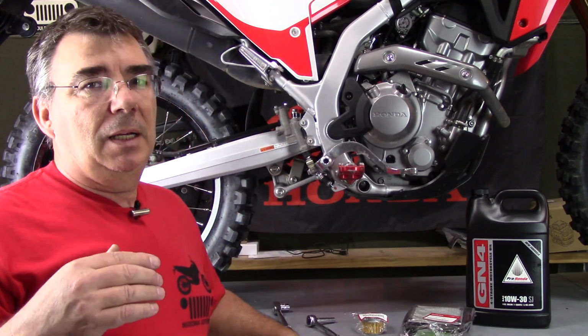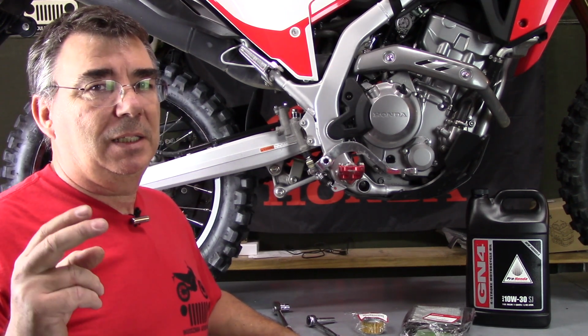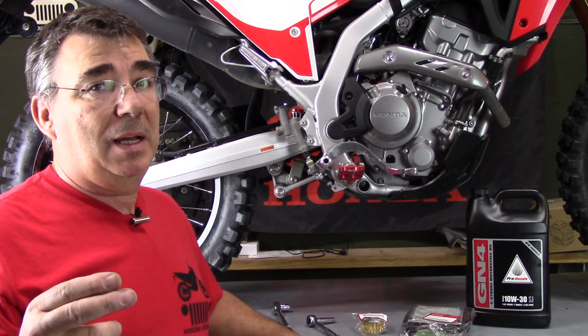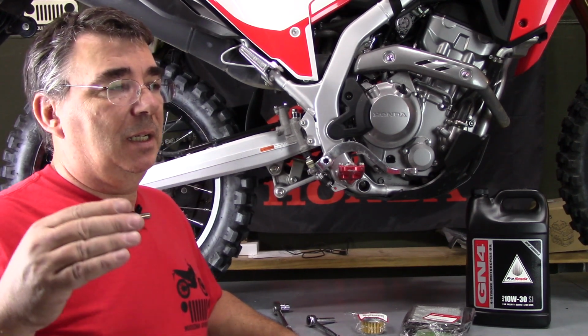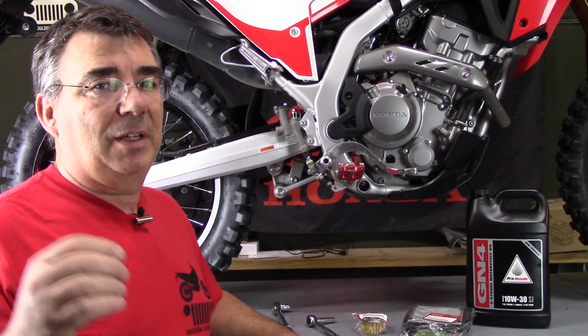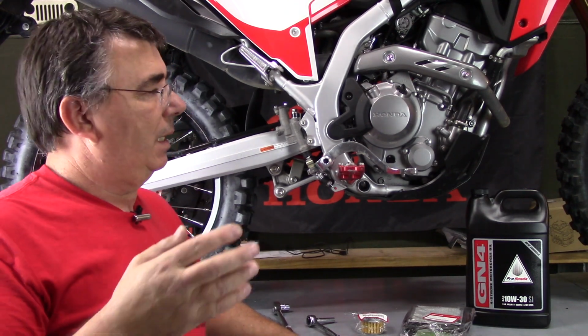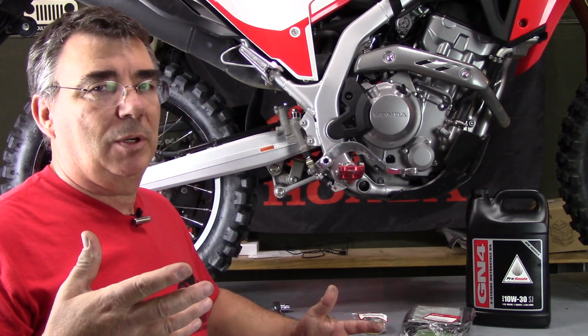What I do is I change my oil at 300 miles for the first change, and then my second change, I change it at 3,000 miles. In the book, it does say every 8,000 miles. It says 600 miles for your first change, and then every 8,000 miles on your oil change after that. But oil's cheap, and I like to keep good oil on the bike, so I go ahead and change mine every 3,000 miles. It always seems to work out good.